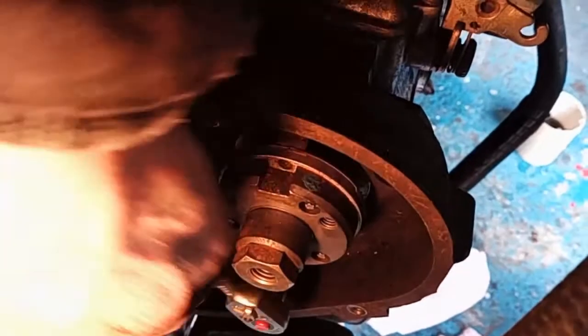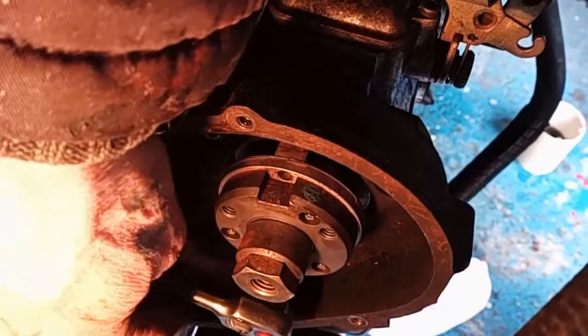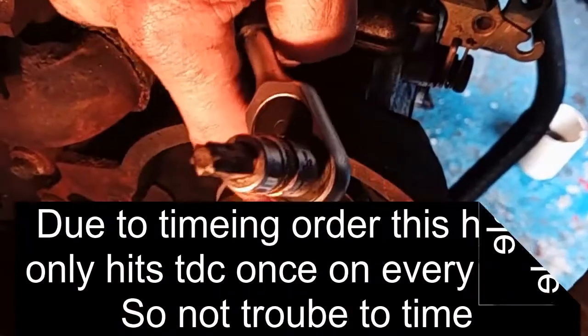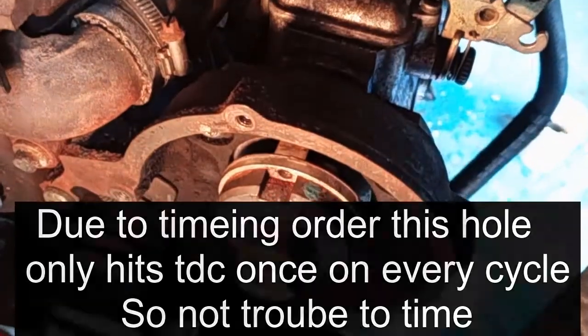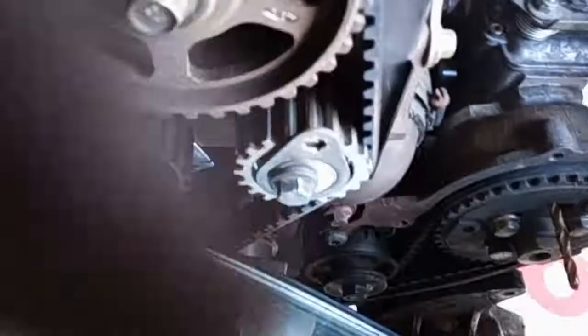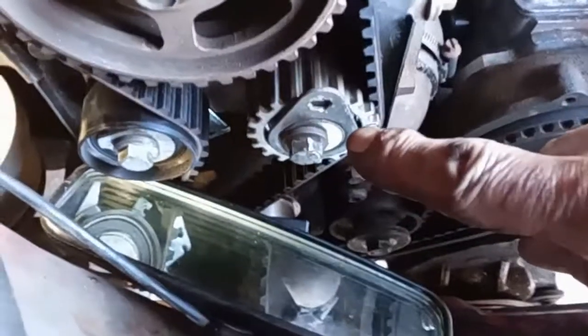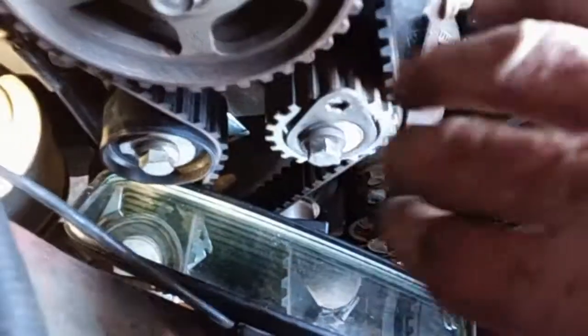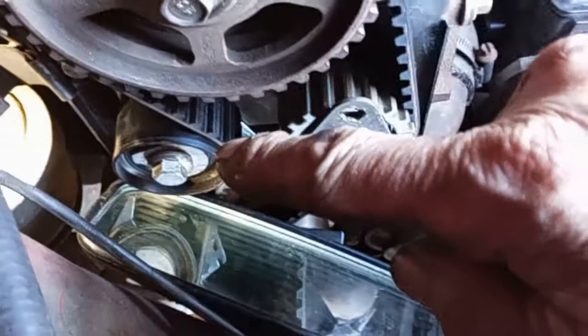Right, the pump's been put in position. Timing mark's in the top where it needs to go, but it's pointless putting the pin in that hole. There's a timing pin hole there, just there. But it's pointless doing that until I've got the thing in and ready to time. For the others of you that know, or some of you might not, this is the timing. This is a teardrop pulley. When you alter that, this cog here tensions up on this belt here, which automatically tensions that one.